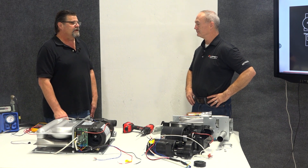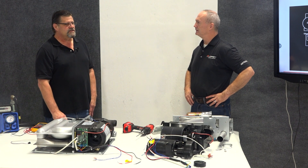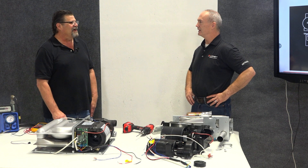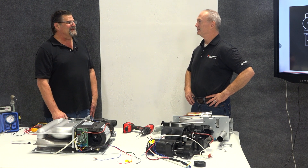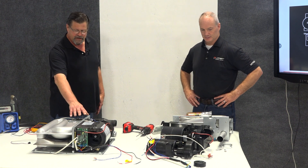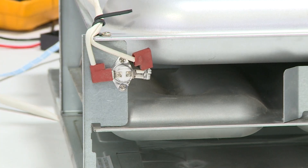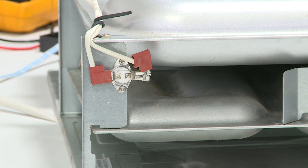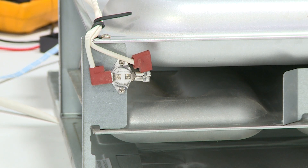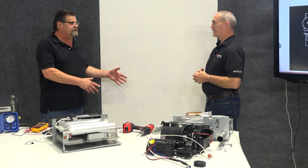It'll also not warm up the RV right, and it seems like it takes forever to warm up because it'll start cycling on the limit switch. That is the nastiest term we have with furnaces — cycling on the limit switch, it's worse than intermittent. There's a little limit switch in the back of the furnace — it goes by names like TOD, ECO, and others.